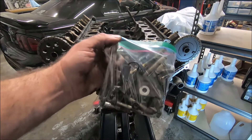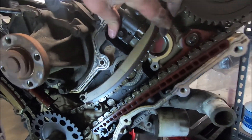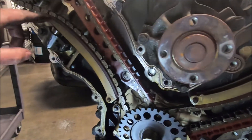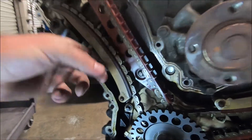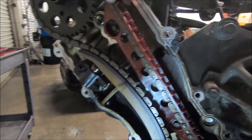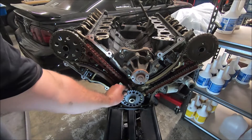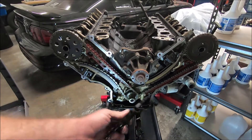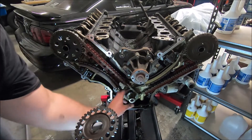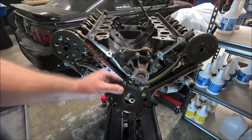Once you've got it off, it's also a good idea to keep everything that held it on in the same bag. Now we can see inside here and I don't see anything that looks way out of place. A lot of times these will be worn through or have lots of play. The plastics look old and a little loose. I'm going to take the crank reluctor wheel off — there are two different styles of these. This is the thicker one; there's a stamped steel one that comes on the one-piece. They're not interchangeable depending on what gear set you've got, so we don't want to lose this.